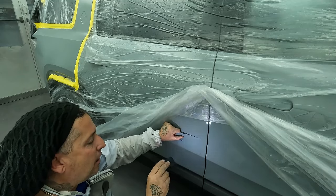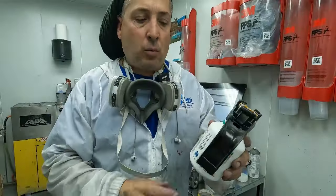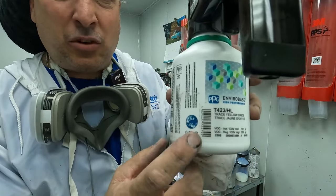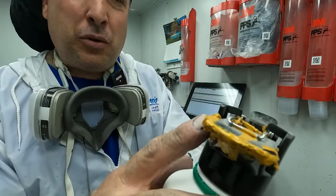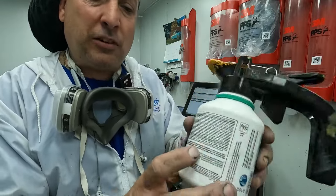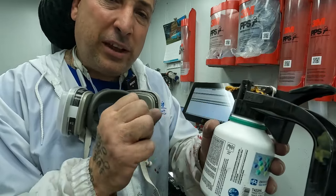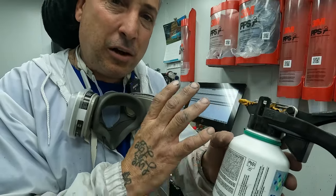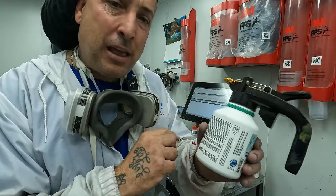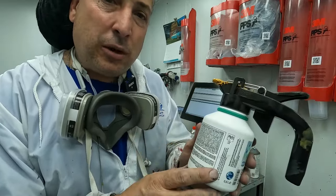So we're gonna go ahead now and get this thing a little bit yellower, and I'm gonna show you guys what toner that I like to use to do this. All right, so what we are gonna add to this one is gonna be the Trace Yellow. That is the 423 in the actual PPG line. So there's a lot of these yellowy colors in the toners on any mixing bank. This is the one that I like to use, especially the one that says Trace on it, because that's gonna have a little bit of transparency to it, so it's not going to be that strong. It's just going to give us that nice little effect that we need. So we're going to add in this one here. By the look of the way that that looks to me, I'm going to go ahead and put in 1.5 grams of the Trace Yellow and see what that does to it.